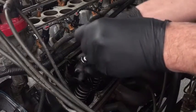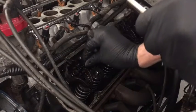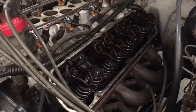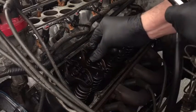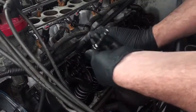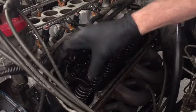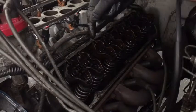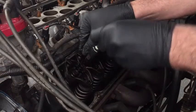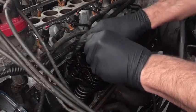I'm going to tighten these down slightly, put them both on again. Let's put this one in there, back in the hole. I'm just going to get them down enough. Really, to be judging this correctly, the lifter should be down all the way. That one's not, but this one is. I'm just going to go by one — if one's like that, they're all like that.